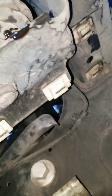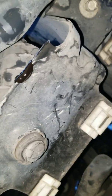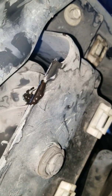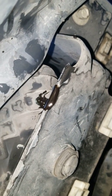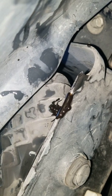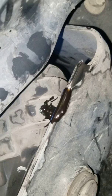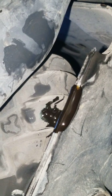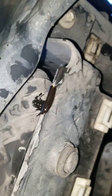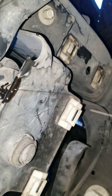I am under the 2011 F-150 EcoBoost 3.5 liter. Just drilled the weep hole on it. It's supposed to fix some stuttering issues from condensation. Just wanted to show where it was — there weren't a lot of good pictures. I'm just under the truck, under the very front.